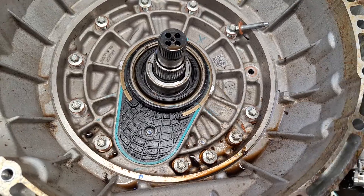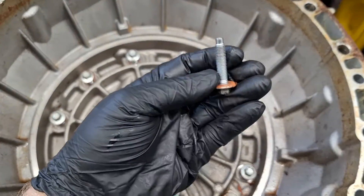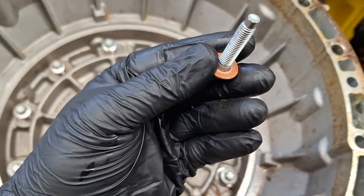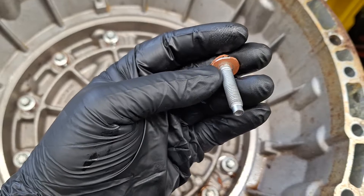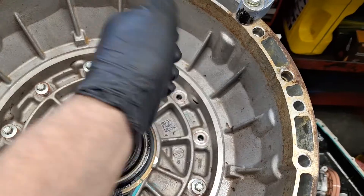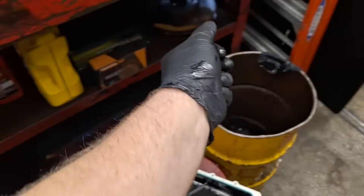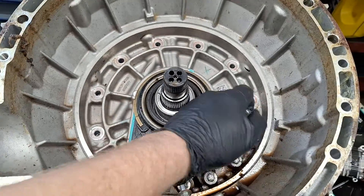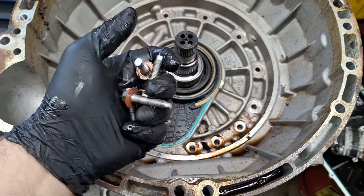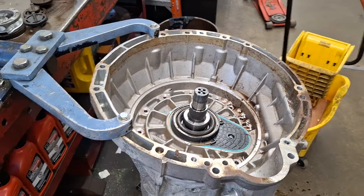All the bolts are loose. Some of these bolts come with seals on them — you want to replace the seals, but these have silicone on them, so you want to replace the bolts or clean them and apply new transmission RTV silicone. This is a warranty repair so I'm replacing the bolts — and I always put new bolts in on non-warranty repairs too, just to be clear.